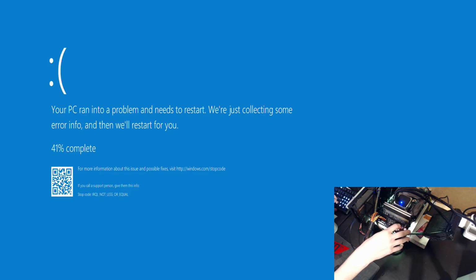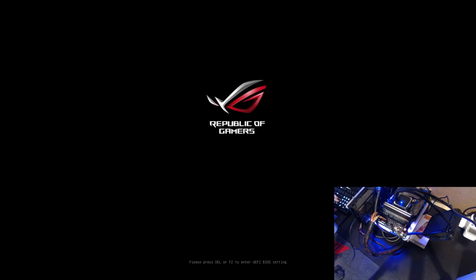So what we're going to do now is safe boot. I just press the red button next to the white button on the Apex. That's the safe boot for this board. It'll boot us in with completely bone stock settings, and I actually wanted it to crash. So that's a win for me here, because there's one thing I still haven't set in Windows. So we're going to go all the way to Windows now. I just have a bad habit of mashing the delete button with this system. Just like, oh, the system's booting, delete, delete, delete.